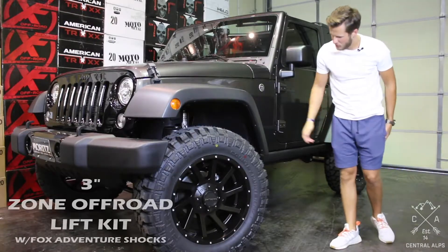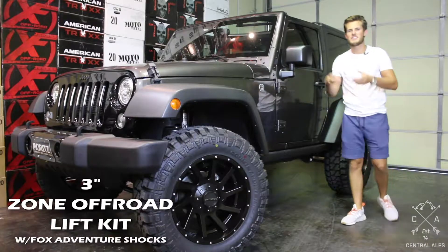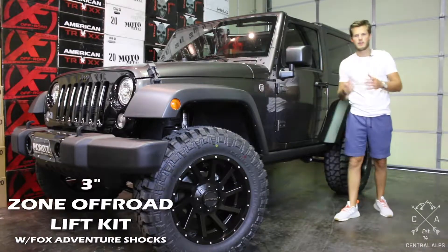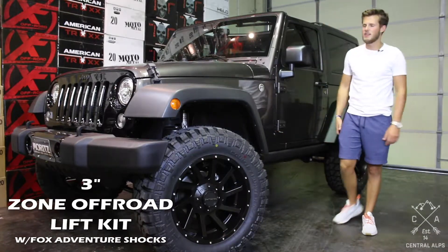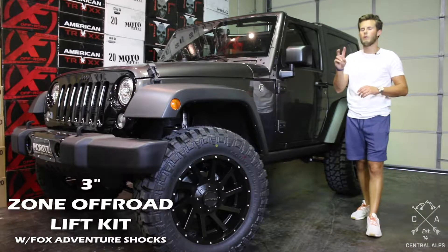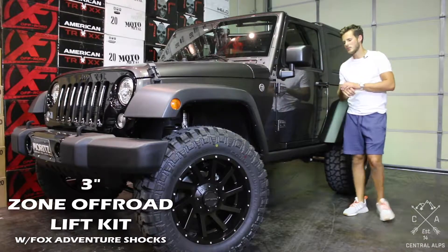So let's talk about this lift. We added the cam adjustment blocks on the bottom of the lower control arms. What this does is it takes your axle and shifts it forward a little bit so that your spring will go back to your factory ride position. That's really our main tip going in there — you'll need either a small reciprocating saw or a chisel to notch out little notches in the bottom of your lower control arm mounts.